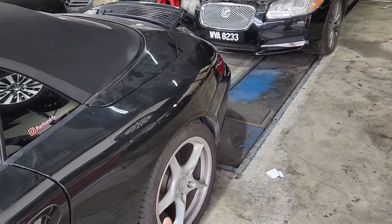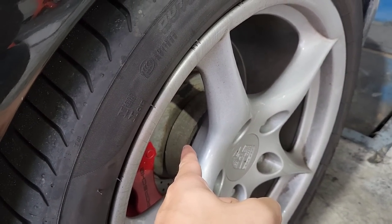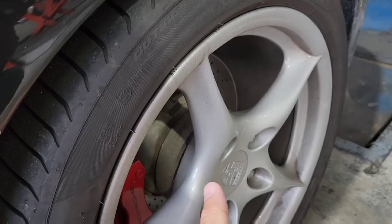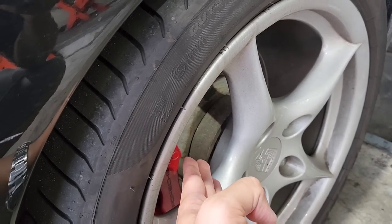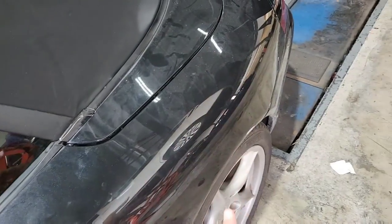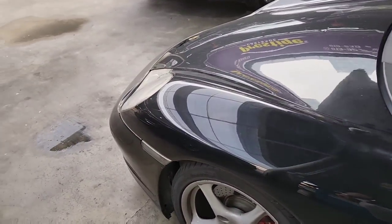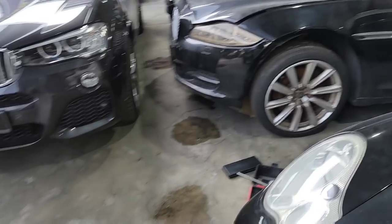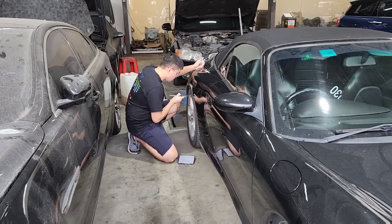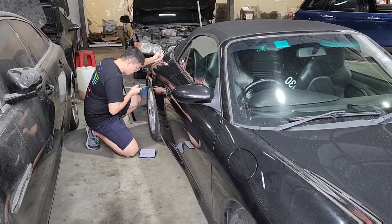The problem with my car is that you look at that giant spacer. Yep. So the previous guy just simply chucked a non-wide body wheel with a spacer that is almost 2 inch at the back, just to fill up the gaps, which is nonsense, absolute nonsense. So that's why Denzel is here, very professional, DRC, and he's gonna measure the offset.